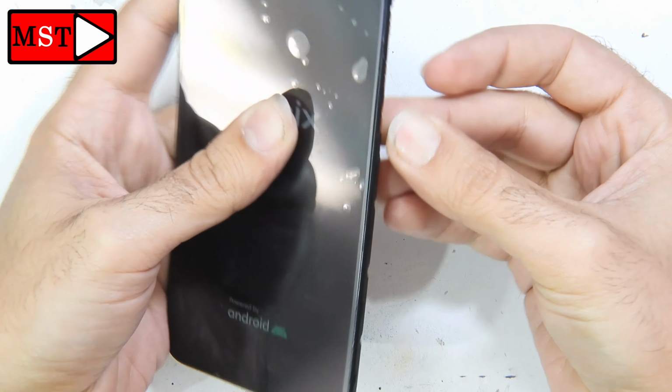Put the battery in, connect the battery. Make sure the wire antenna is in position. We don't want to damage it when we close the back case. We may damage that antenna. Put the loudspeaker shield on, screw it down, put every single screw we removed.